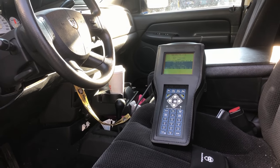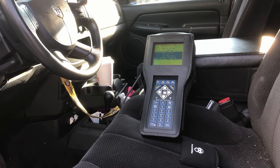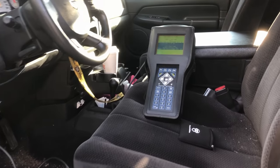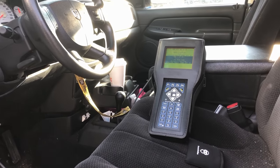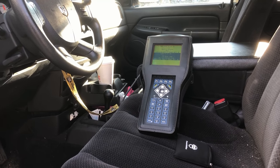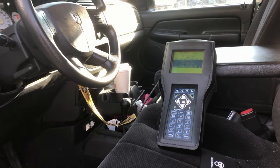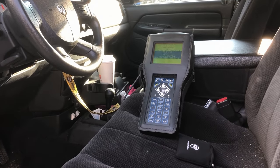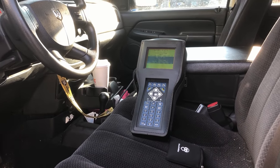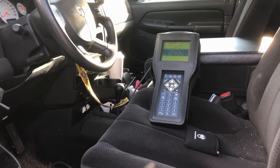Just for diagnostic purposes, pretty much all newer cars do this: if it sees a circuit fault on a lighting circuit or any kind of an output, typically the computer will shut that circuit off, and that will affect your diagnostics. So if you unplug a circuit and go to check for power where you think there should be power and you command it, you may not see power — not because there's an open circuit or because the module failed, but because the computer shut that circuit off to protect itself.